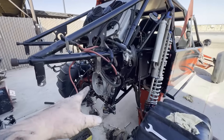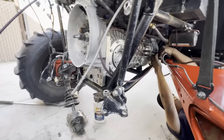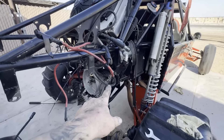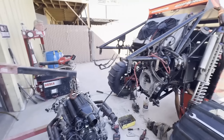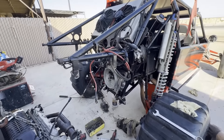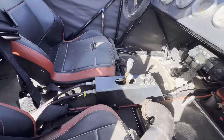The transmission is back in and we're hooking up the shift cables now. I do not like how these shift cables are routed around the CVs like that, which makes me believe this car was probably not a sequential car and all this stuff was added on later. If we get some time I think Joe and I are going to go through these shift cables and put the other shifter in this car and do it right - so when you're shifting you pull back for forward gears. In the off season we're going to revisit this shifter - shorter cables and a different shifter.